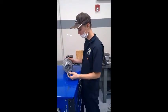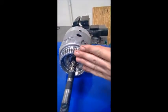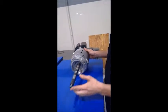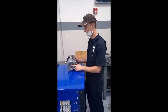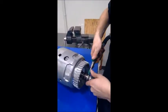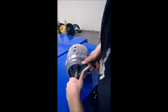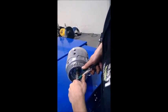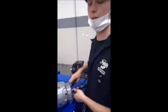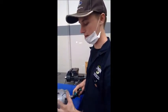On the output shaft, there will be 3 to 6 holes on it for the clutch packs to actually compress with the frictions and steels. Normally, through these ports would be transmission fluid, but we're going to simulate that with air pressure to see if the clutches move at all. So go to the first hole in the joint on the output shaft. Check it. I can hear a thump, and normally you want it pointing away from you so that if there is something wrong with this drum, it shoots out that way instead of actually going into you.